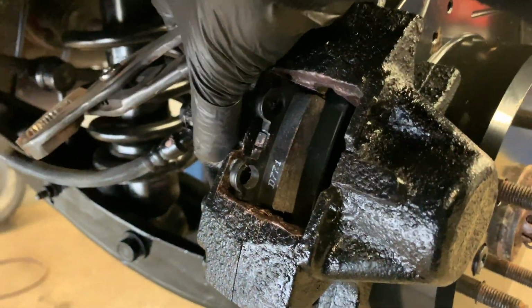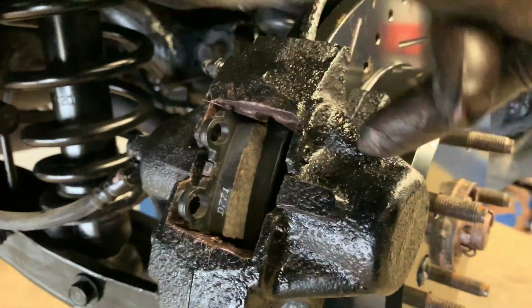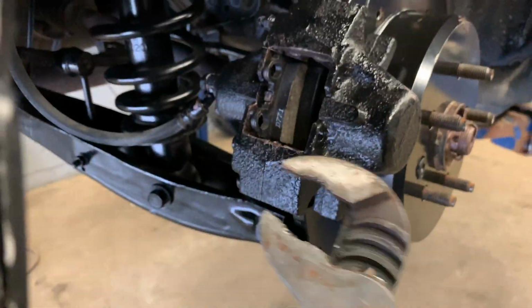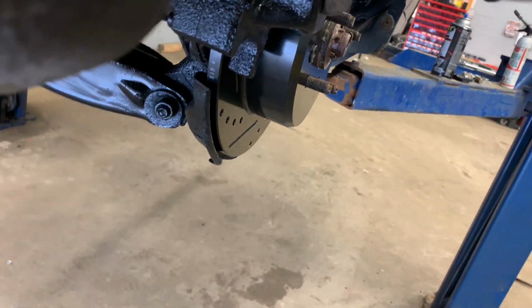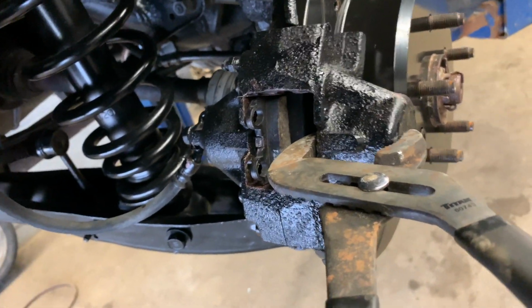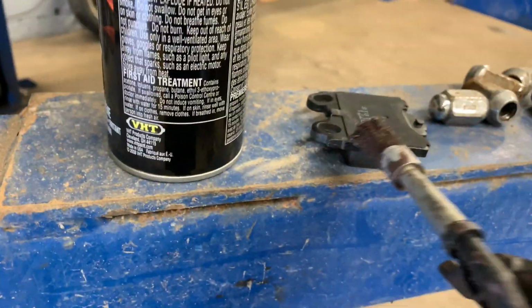Now on these rear calipers, there's a piston on this side and there's a piston on this side. So the easiest way to do this is to put your first pad in on the back side, grab a set of channel locks, okay? And you're gonna get in, one sec here, switch up the hands, throw some tools. Okay, and you're literally gonna get on in there like that and just squeeze. All right, now that she's like that, now I can get some paste on this one.